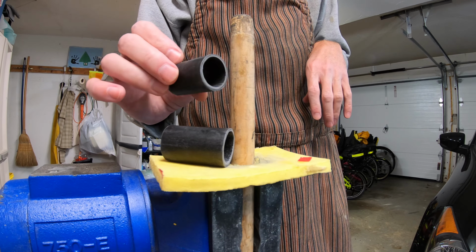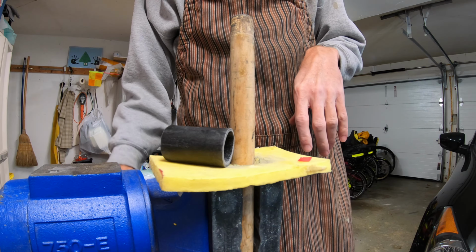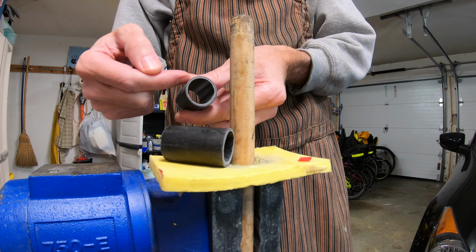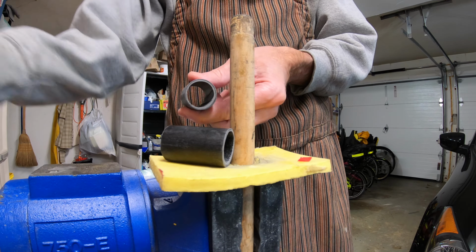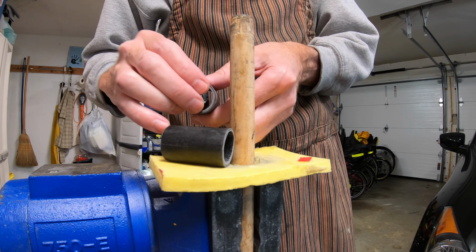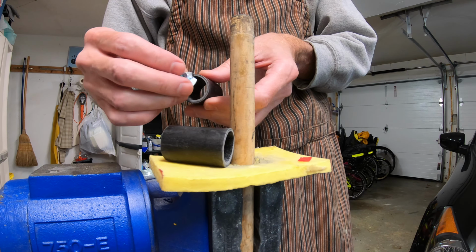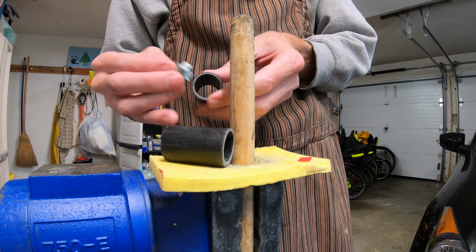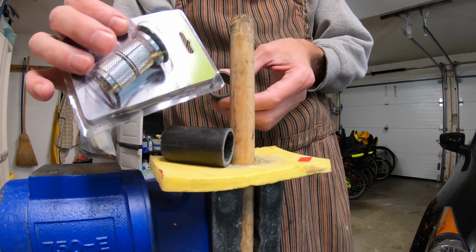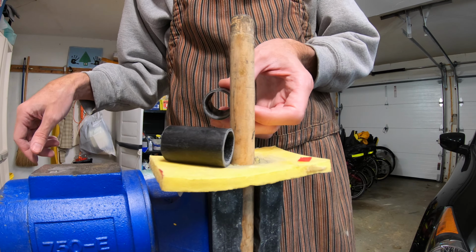We'll see how much torque it takes to crush a hunk, and then we'll throw a plug in, and I'm sure I'll be unable to crush it. Part of me wonders if we wouldn't be better off skipping the plugs and just doing an epoxy fill all the way down in there with something like one or two of these M6 nuts centered in the middle of that fill. Now, I'm not saying hard edge, I'm saying completely surrounded by filler, so that you have something maybe even better able to withstand the crushing forces than this, which is aluminum, but it's based on a wedge, which could come loose. Anyway, let's crush a hunk of fork.